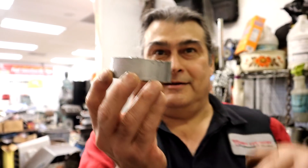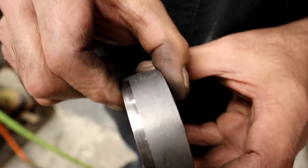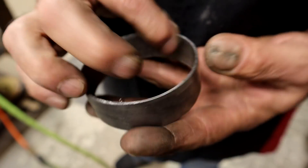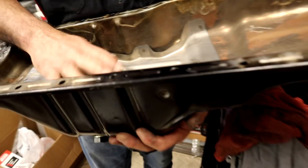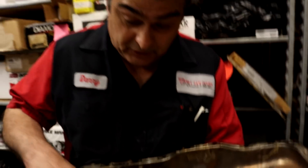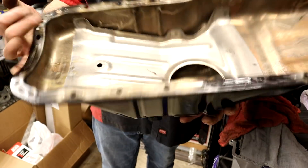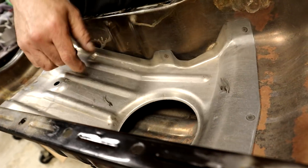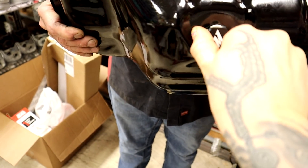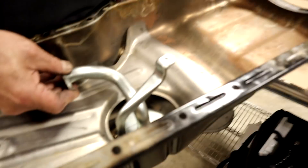We're trying to make it flatter — get it nice and square, meaning the same size everywhere. It looks pretty close to round. It does have a windage — this is a windage, not a baffle. It stays down here at the bottom and off the crankshaft. If you accelerate really hard and decelerate, the oil will go up in here but it won't come back up, so it keeps everything where it needs to be down here. And we'll have this lovely magnetic drain plug that will hopefully grab all the grossness — anything down there will go over there.